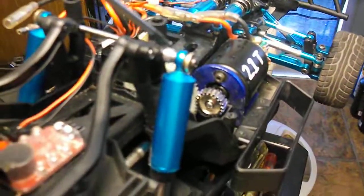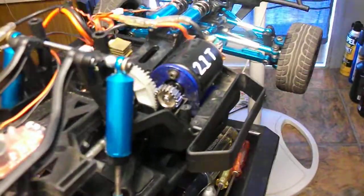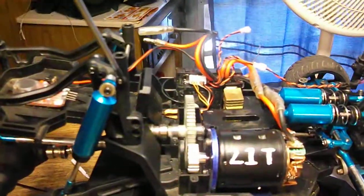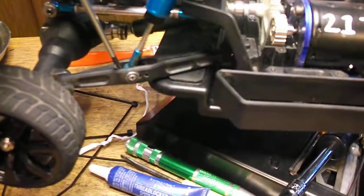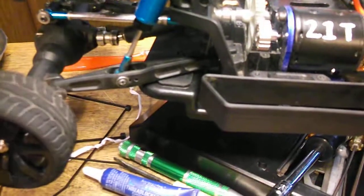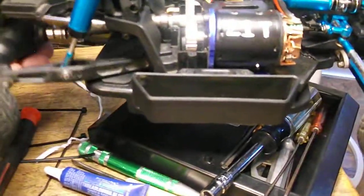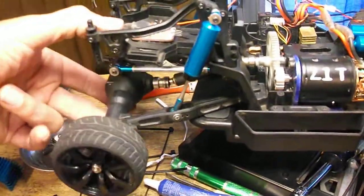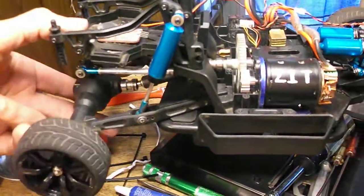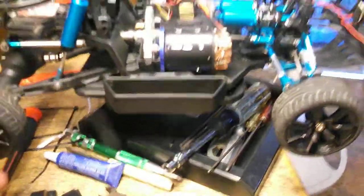You can see washer out here, a spacer in here to get the shock standing up at a better angle. Because I decided to use the tower brace here, I went back to this stock locating hole for the upper mount, and the rear shocks are in the rearmost mount. Lays them down, softens the spring a little bit, and I want the rear end pretty soft. It still works great. You can see it obviously has damping, but plenty of movement, dampens well. The front's the same. The tires are working better now. They've gone to full on-road. The other day they worked well.